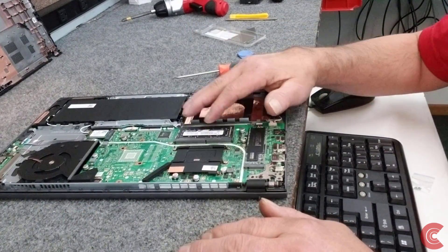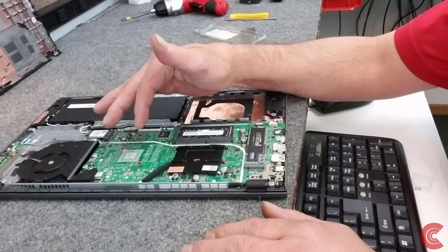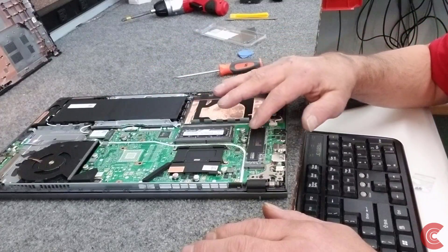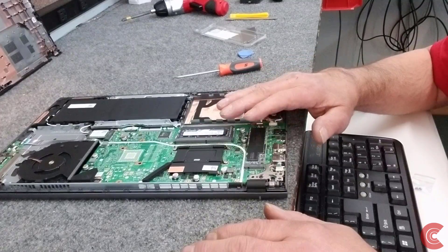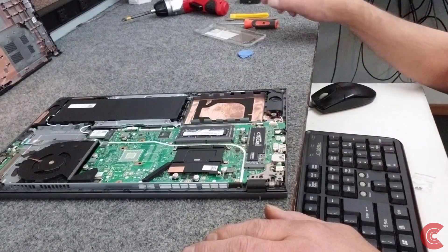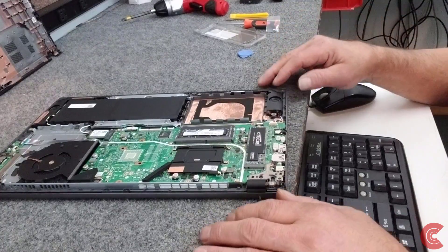So that's it. We upgraded the RAM — we've got 4GB of memory on board, and this 16GB stick will give us 20GB total. And then we got a new SSD in here giving us 250GB instead of just 128GB. That's what the customer wanted, so that's what I did.